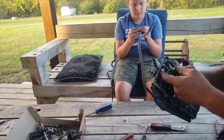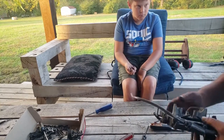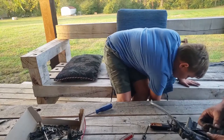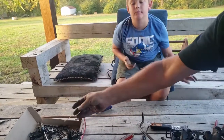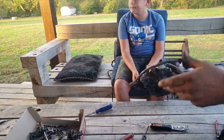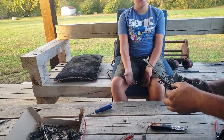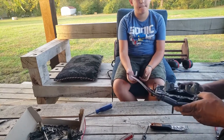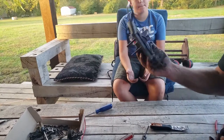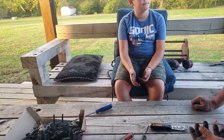We're going to pull this little rubber thing out right here. And we'll have to take this little plastic line off. And there we go. There's our little plastic line. And that's as far as we're going to disassemble it. Now, we'll go ahead and take this piece off, too. There's no reason to have that on there. We'll put it back on, but we'll take that off. But anyhow, there's your thermoquad taken apart. So we'll get it into the dip and clean it up. And you and me will get back together and put it back together.